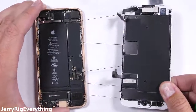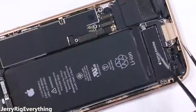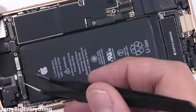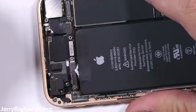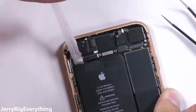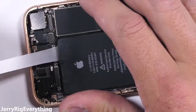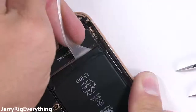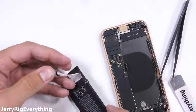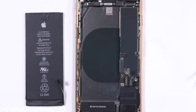There's quite a bit of black waterproofing adhesive around the whole edge of the screen. Now that the screen is out of the way, let's take a look at this battery — it looks a bit different than usual. Instead of two magical pull tabs, we have four, which is a good thing. If you fail on one, it's not that big of a deal. You grab the lip of the little black tab and pull it out from underneath the battery. As the adhesive stretches, it loses its stickiness. Repeat the process three more times. These are seriously the best way to adhere a battery — no heat or violence required for removal. The four-tab method also keeps the adhesive from sticking to the top of the wireless charging.